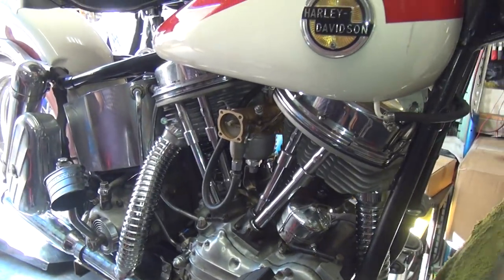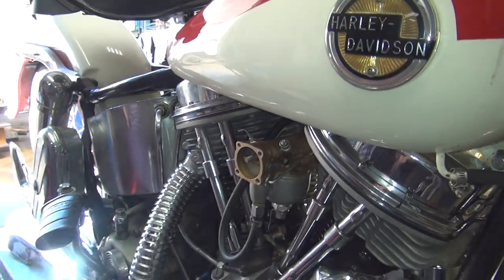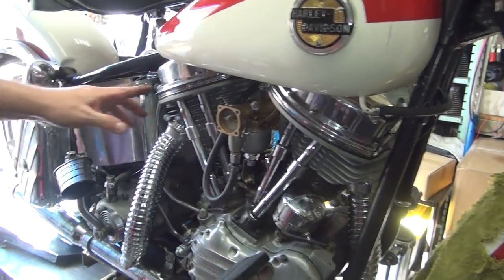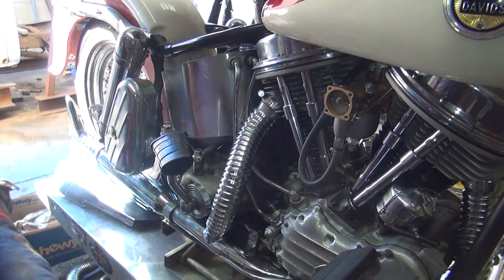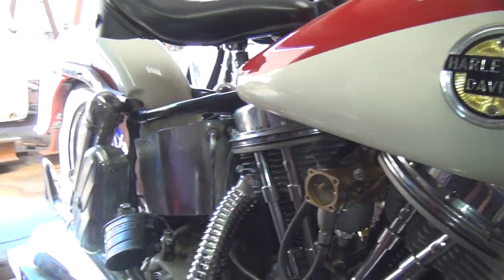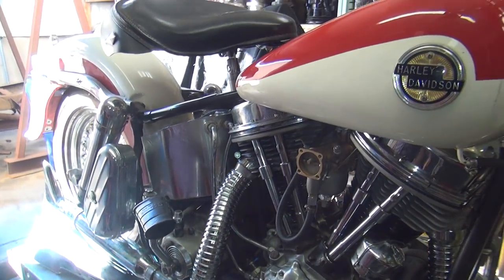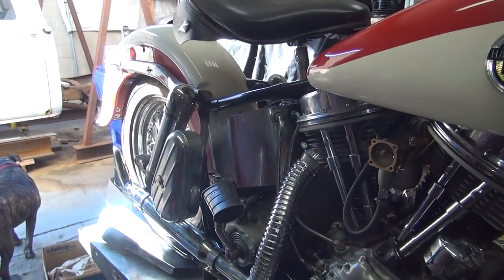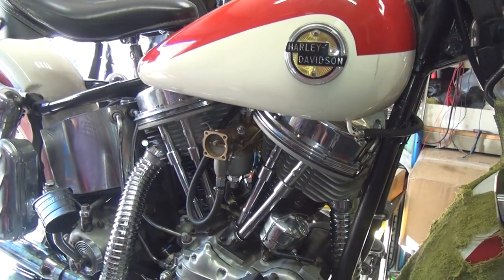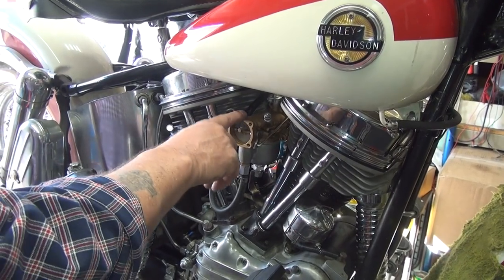The valves are adjusted - the lifters came right up, unlike the '65 where we had that bad lifter. This is actually a bit quieter running than the '65. The rear head is slightly noisier than the front, but they're both pretty quiet. On the '65 the front one makes a little bit more noise than the back one. It's probably about 15% louder on the '65 on the noisy one. Of course all that changes as they break in - every bike is different. This one's got tons of clearance - the other one had to beat the hell out of everything.